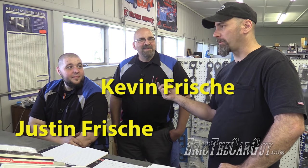Right, so with that information that we just got from CCing the combustion chamber, we're plugging in a calculator to find out what the static compression ratio is. So, what do we have? 8.91 to 1. Really? That's really great for a boosted application, I think. Especially if you want to run pump gas and drive it. I do want to run pump gas and drive it. What do you think? I'm glad I got the bigger gaskets. Awesome sauce.